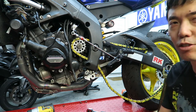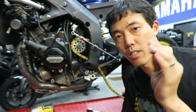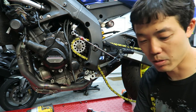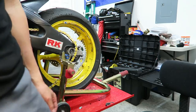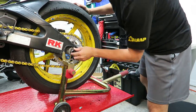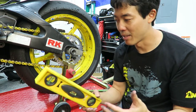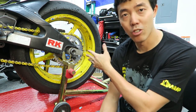Especially at extremely high speeds. One on the bottom as well, and we're pretty much done with gearing. The only consideration now: when you change the size of the sprocket — make it bigger in the front, smaller in the rear — you have to readjust your chain because the slack won't be the same. We do that through the rear axle adjuster. Looking at about one and a half inches of slack. Normally you'd check your tension after a gearing change, but it looks pretty good, so I'm not going to adjust my rear axle.